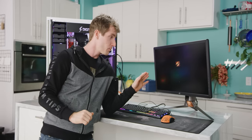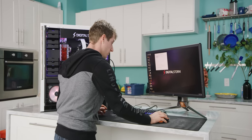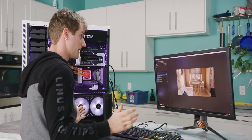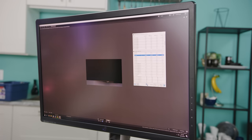Let's try another 2% overclock — now we're trying to boot at 5.2GHz. At 5.1, the value proposition starts to become much more interesting: Silicon Lottery puts the value of a 5.1GHz validated 9900K at about $900 US, considering how few of them can get there. Whereas if you buy a chip that was 5GHz in the first place, a 2% overclock doesn't seem like as much to ask. And in fact we are booted into Windows now at a whopping 5.2GHz, which to my knowledge Silicon Lottery doesn't even offer. We have no idea if this is stable — I'm actually pretty surprised we completed that Cinebench run. Let's do a blender run. 96 degrees — it froze.